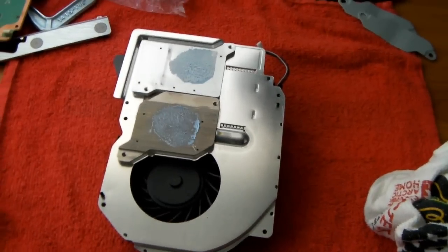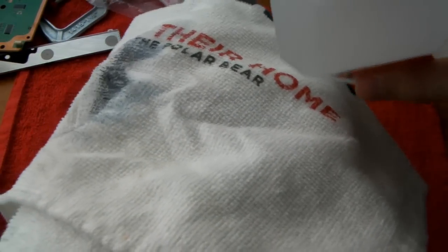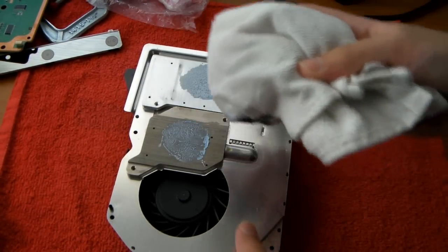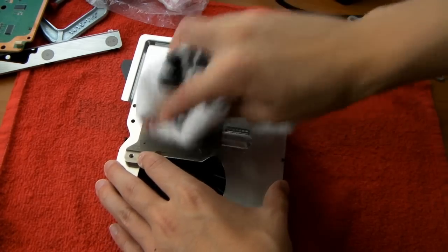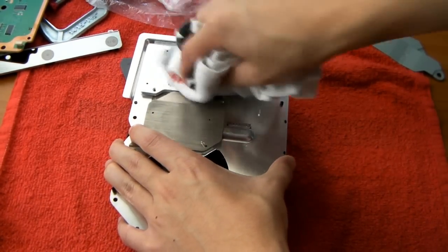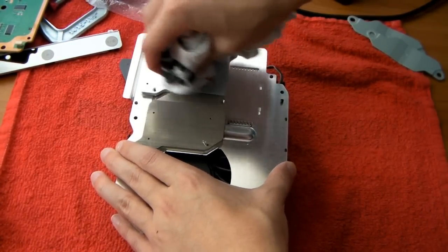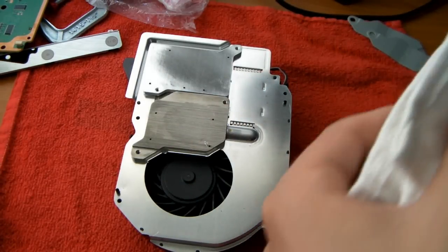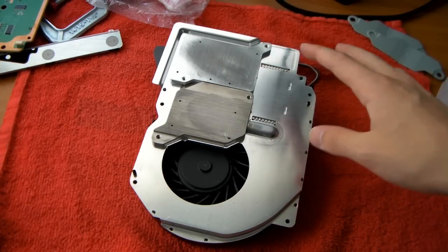And here are the heat sinks. I'm going to get some more rubbing alcohol and rub it off the same exact way. These are a little bit easier to maneuver because they're not sitting on a motherboard where there are lots of chips. Get it off nice and thoroughly. Heat sinks usually have a little bit more staining. Also, try and avoid getting your fingers all over the heat sinks — your skin has natural oils and we want to eliminate that. So that's off. Again, you can see the black stain — that's okay. As long as there's no compound on it, that's what matters.